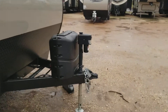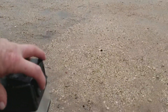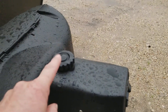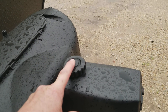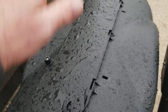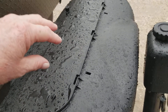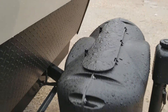You do have your electric front jack up here so you can bring it on and off your vehicle. All you have to do is just up and down and it has a light on here. But if you ever lose power, you do have a manual way to do that. All you have to do is take this cover off and we will give you the tool so you can crank that on and off your vehicle. It has two propane tanks and they are tied to one another, so once one runs out, all you have to do is switch the lever and it goes to the other one, giving you more propane when you're out camping.